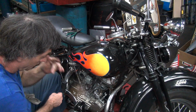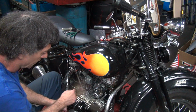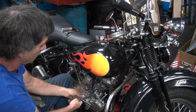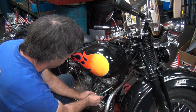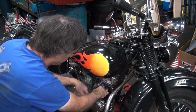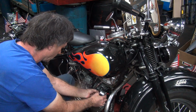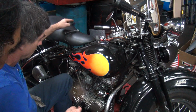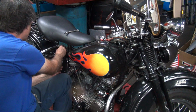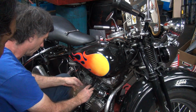God damn. Now we can pull everything back apart one more time to see if we get any power. Now I might be able to disconnect it, which makes things a lot easier. So where is my pliers? Blue handle pliers right in front of me. Okay, so boom. Wire's still here. Ground is good on that. Power's on here. We have no power through the wire.